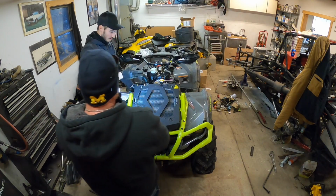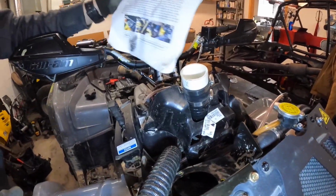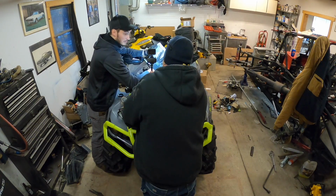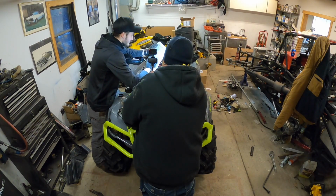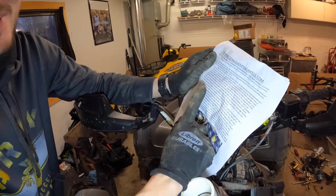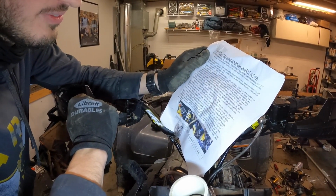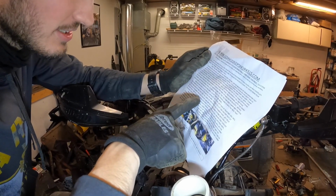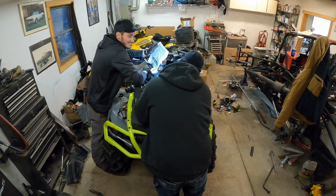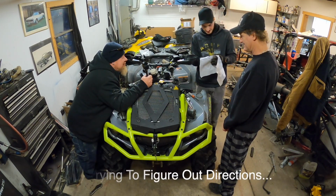So now this is just very long. I don't know if it might be going on this side possibly. Yeah, that's why we're removing the thing. Yeah, very possible. Next we're gonna be doing the belt exhaust. So it says go to the left side of your XMR. Oh, I know, we're working on the XMR here. You will see a rubber duct running. Yep, I think this is the duct that screwed me there in the mud hole. The duct over here, this guy, running up the side of your bike. You'll need to cut the factory duct at the second ridge in this duct, past the curve in this duct, in the straight part. Them directions though. The set is showing the cut down by the fender here. But it's showing, what the heck is that?